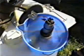Right, on the Rover, on a solid unit, it runs around about 90 on the temperature gauge. When you hooked up the solid unit to it, it went to instant cold. The motor just ran dead cold, and it wanted to perform better on dead cold, and you couldn't get it hot. And you take it off and put it back on the petrol, it would come straight back up to your medium or normal running. It would even override your thermostat, everything. So that means that there is a reaction in your motor.